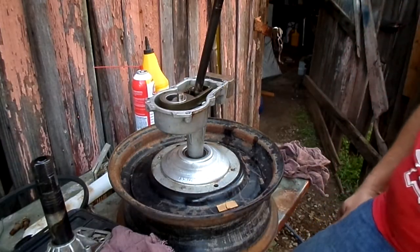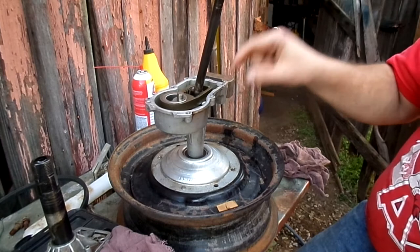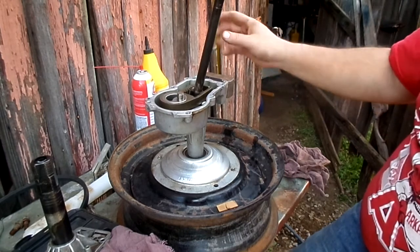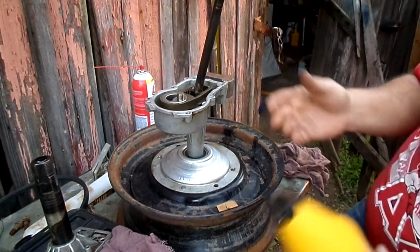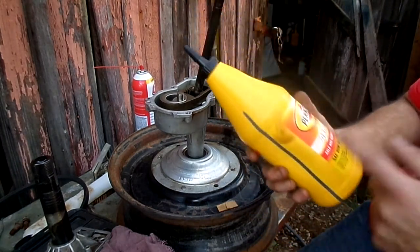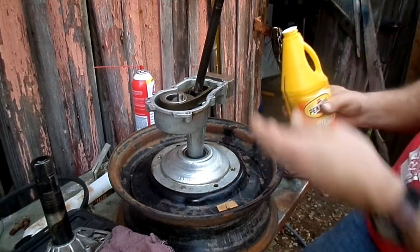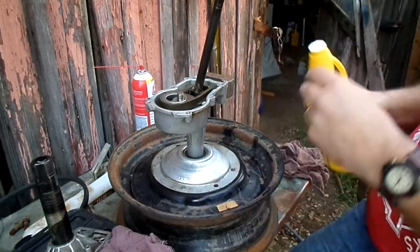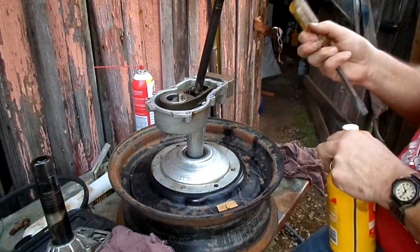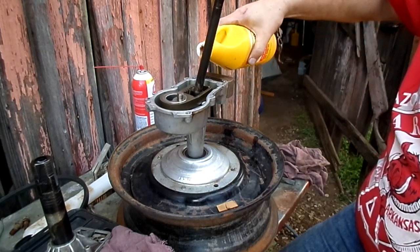As kind of an addendum, I realized I glossed over the gear oil side of this. I don't know what the factory calls for, but it most definitely was gear oil — you can tell by the horrible stench it puts out. It wasn't a real thick viscosity, so I'm assuming it's one of the lighter ones like 75-90 or 80-90. These viscosity grades aren't real critical anyhow — the important thing is just to have oil in there. So all I'm going to do is pour it in until it's almost to the top.